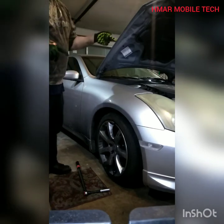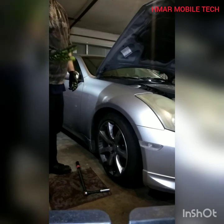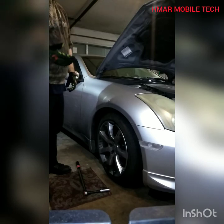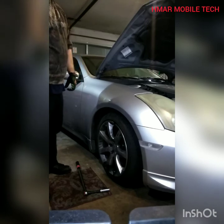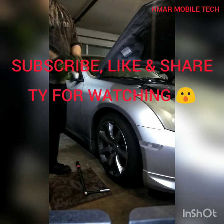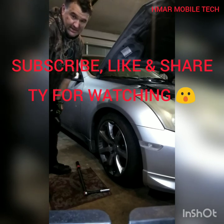Last thing: make sure the brake fluid is at the proper level. Then step on the brake pedal five to seven times until you feel the pads seat in and the pedal gets firm. Go back and forth in your parking space to confirm it stops before driving it. Make sure it feels good and safe. If you have any doubt about wheel lug nut tightness, immediately stop and get that taken care of before any more driving or returning the car to the customer — it's very important that lug nuts do not come off. Thanks for watching — this is HMAR Mobile Tech, David in Sacramento. See you next time.